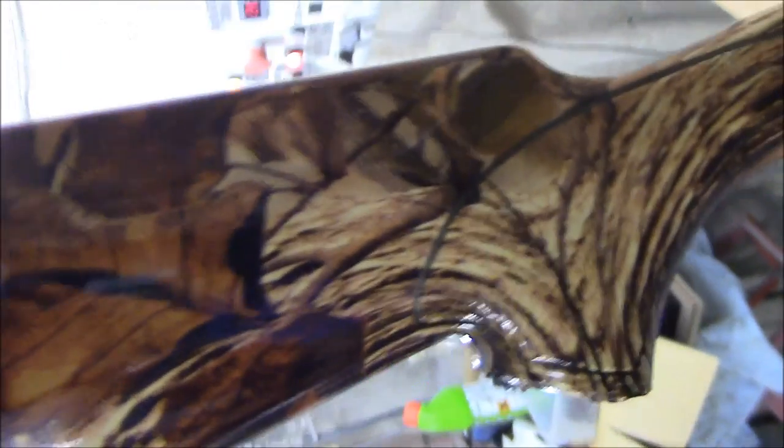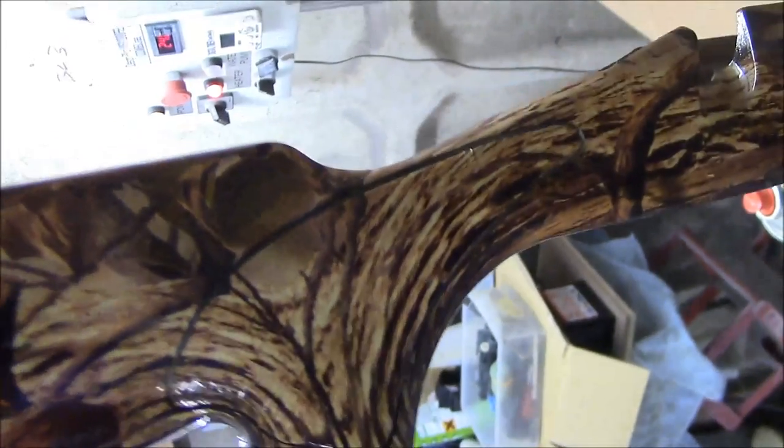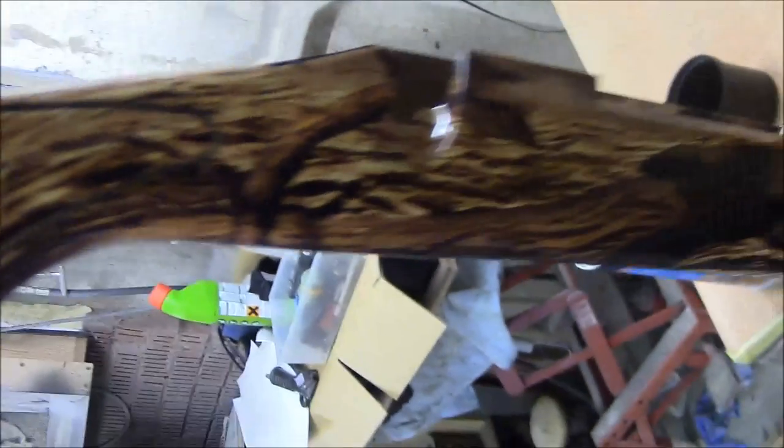Once you've sealed it in, your actual UV attack is going to go on the top coat and not on the dip, hence we don't get pink cars anymore. In the olden days, the 1K reds, Vauxhall Novas, were a nightmare for it, and the early Mark III Escorts and Mark IIs, some turned them pink. But we'll be on that now, because the majority of modern automotive finishes are clear over a base coat.